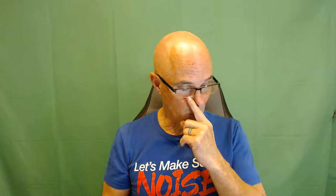What I recommend for people when they're trying to do that, whether you're trying to make an intake manifold, because we've talked many times about different runner lengths, same thing happens with primary length on headers. So if you have a header and you want to optimize it for your application, we have guys that are really sharp that can do math. You can take a look at the exhaust programs, but I've never seen anybody be able to use those and do what actual testing does.